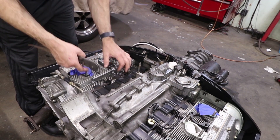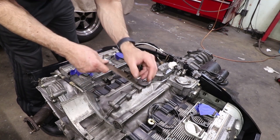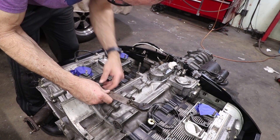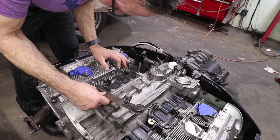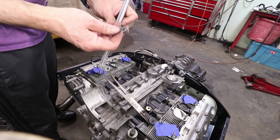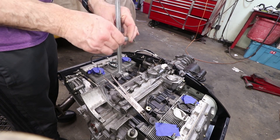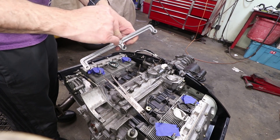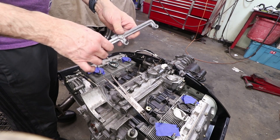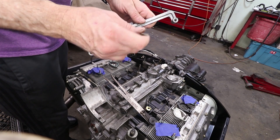In addition to using the fins on the cylinders, I have these pointers that I can clamp down to measure the distance from the end of the head or to the end of the fins to the end of the part. Drill bushings are commonly very hard steel — I could buy some, but I also have these roll pins that go right inside here. They're a tight fit, so that can serve as a drill bushing so I don't damage the surface of the aluminum. That's going to guide the drill right down the center, and this drill bit fits inside this bushing just perfect.